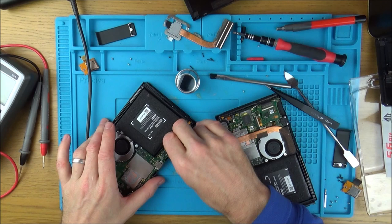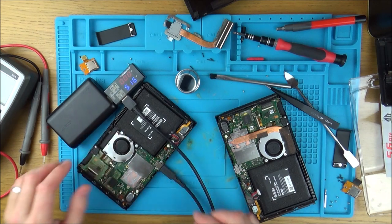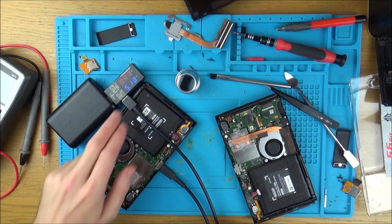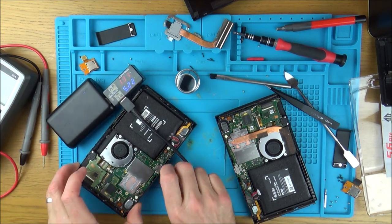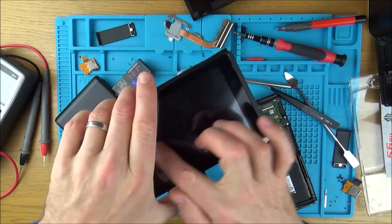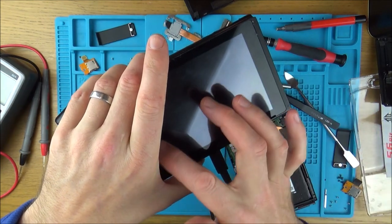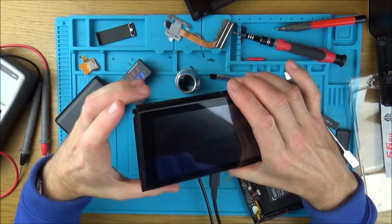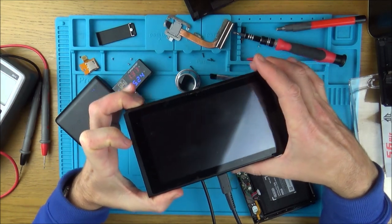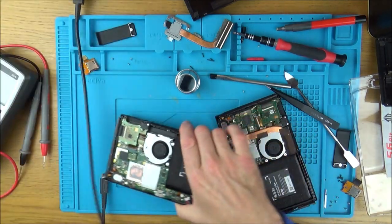Let me plug this one in and see if we get any life out of it. It's at 0.41 — let's see if it drops down. Yes, it's dropped. Brilliant — 1.31, so the switch should now be on. Excellent result! It looks like the battery will be saveable. Now we have to find out what's happening with this screen. Let me turn it off by holding down the power button. There we go. That's really, really good news.